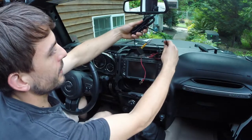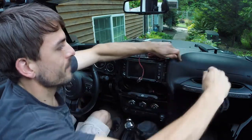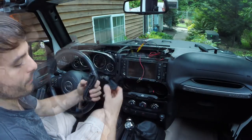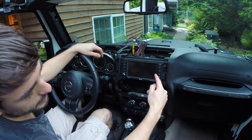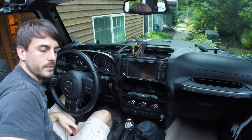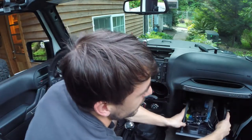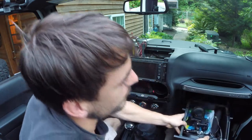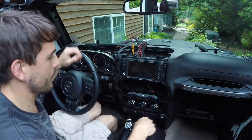First thing I'm going to do is disconnect the camera from the rest of the harness so it's out of the way and I don't have to worry about damaging it — plus this guy is going to be routing from the back in anyways. I intend to route it down the backside, put it in behind the glove box, route it down to the passenger side kick panel, and all the way along with the harness going back. The glove box is pretty easy: two tabs folded in with pressure and it comes out, giving me access to route my cable along there.